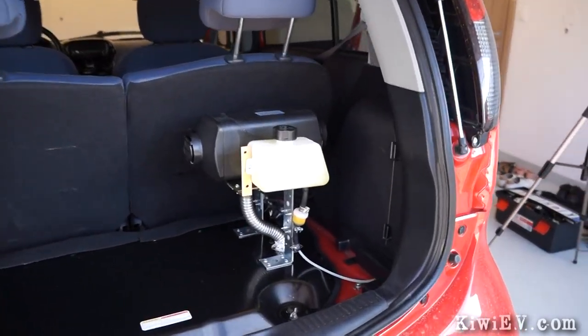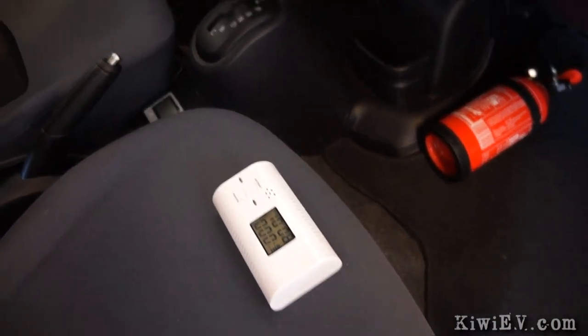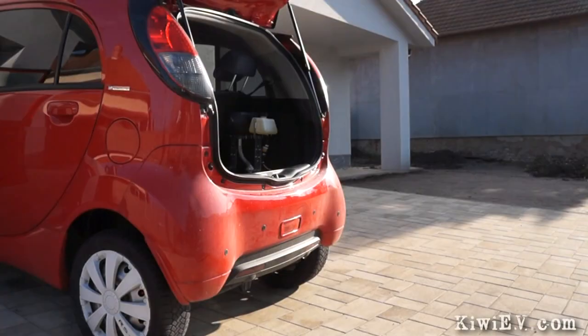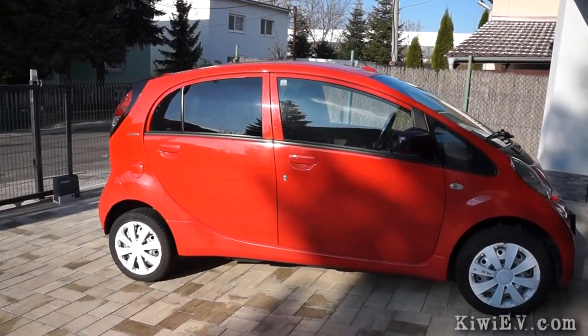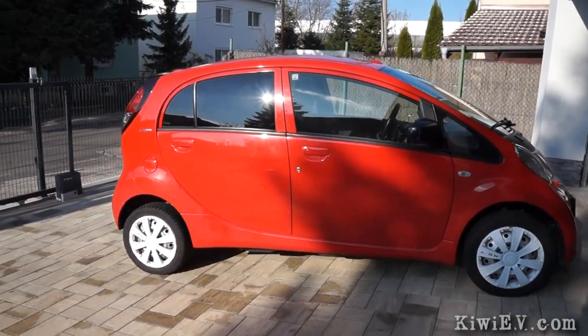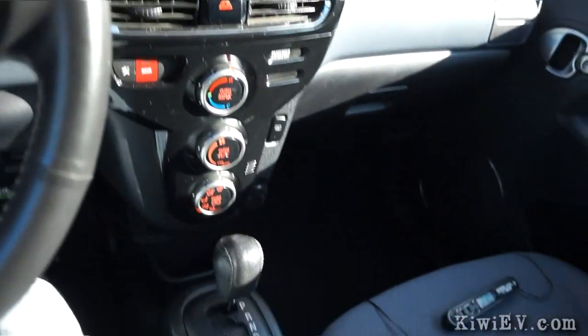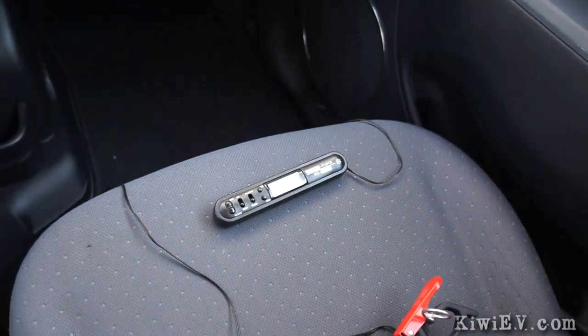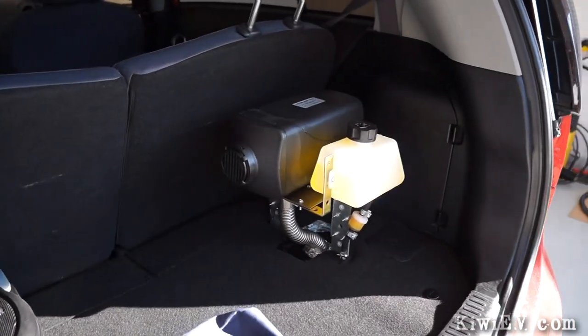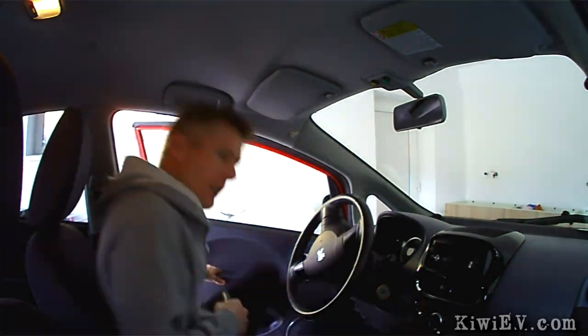It's the next morning. This gives you a better view of the heater installation in the back of the car for the winter. In the passenger compartment I have my carbon monoxide detector and the control panel for the heater. After inspecting the fuel and exhaust system again, I tested the system once more in daylight. From outside the car you can hear it, but it's not very loud — a bit like a loud fan, or one of those horrible noise generators new electric cars have to have. After about 12 minutes at just below full power, the car is already up to 23 degrees Celsius — much better than I expected. The temperature kept climbing even on quiet mode, reaching 28.2 degrees Celsius. I then put the carpet back in and got ready for serious below-freezing real-world testing, driving to work and back.